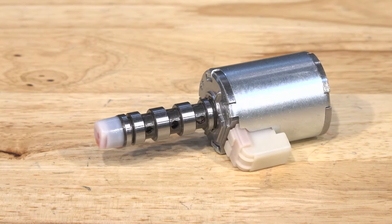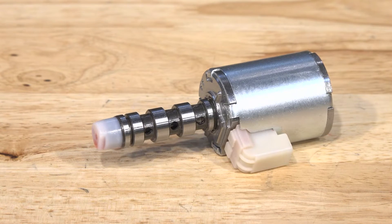So Mike, what's the function of the clutch solenoid? The function of the XD306 is actually to apply transmission fluid to the direct drive clutch when commanded by the TCM. And are there any common signs that the solenoid is not working properly? Some of the common signs would be either slipping when the direct drive clutch is actually engaged, or a lazy or very soft feeling shift.